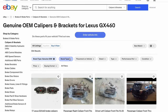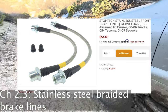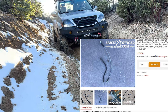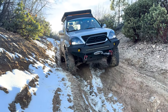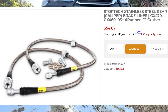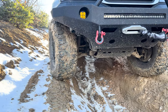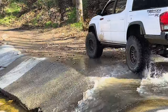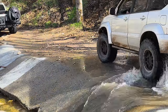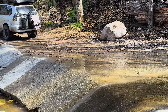In addition, consider upgrading to stainless steel braided brake lines throughout the entire system, not just on the front calipers. There's a flexible line from the body to the rear axle that should be extended and upgraded to stainless, in addition to flexible lines on each rear caliper that need to be upgraded in order to ensure a significant improvement in brake feel and stopping power. If you leave even one rubber line in place, all the ballooning effects will just go to that one rubber line that's still in place. So to get that tight brake feel, make sure you replace all of the brake lines in your system to stainless braided.